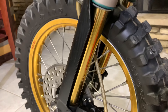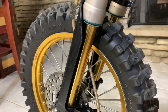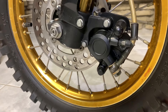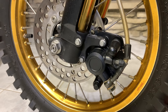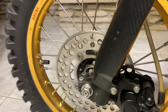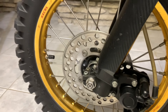They do have gold stanchions, which are beautiful. Those are the SKF seals — those are the ones I'd recommend you go with if you're going to do any work on your forks. SKF is the seal to go with. This bike came with a knockoff brake on it — that is not a KX65 brake. I definitely intend on changing it and running a bigger rotor, a 200 millimeter rotor. This is a KX65 factory 180 millimeter rotor.